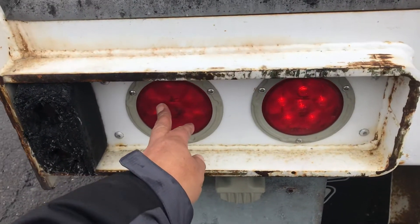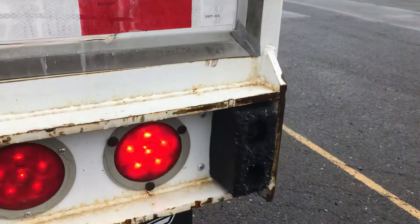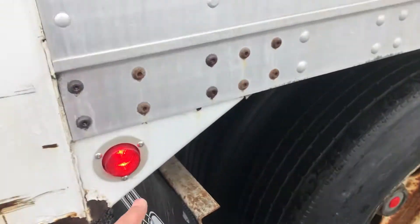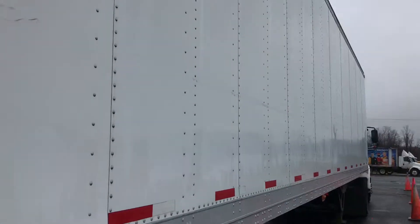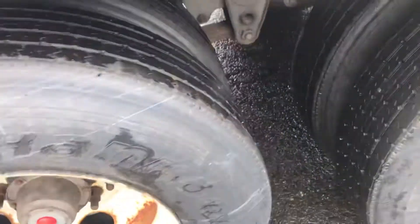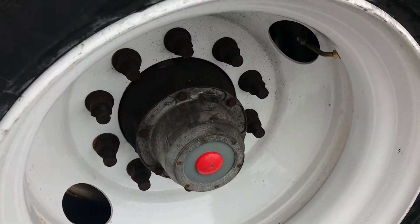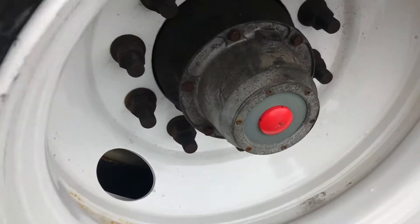My left marker light and tail light — red in color, clean, not cracked, working properly. My right turn signal light is now amber in color, clean, not cracked, working properly. Side of my trailer is clean — no holes, no damage. At least 50% of DOT reflective tape. I'll kick all four of my tires for proper inflation. Both my sidewalls — no cuts, cracks, or abrasions. Both inside my rims — no cracks or welds. My lug nuts and hub bolts are not broken or missing and not leaking — no rust, no shiny threads which indicate looseness — that's where I would fill and check.